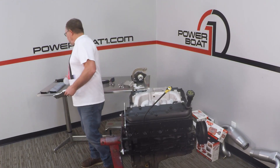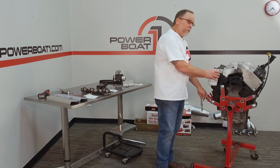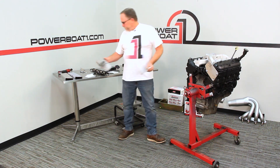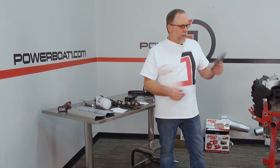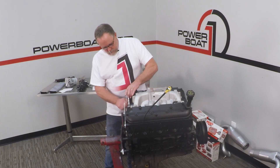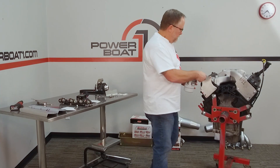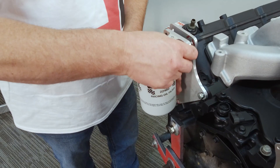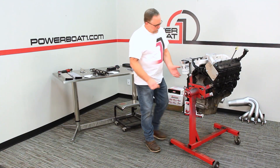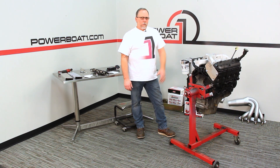Now let's do our oil filter bracket. We want to put our oil filter right up here so it's close to where the oil lines come out from the oil pan — we'll be able to just make nice short little lines right into our filter. If you wanted to run a cooler you could do that too, but we're not going to in this application. Same thing — cardboard template — and it is just going to bolt right in here. It'll end up with three bolts in it, and then we're going to tap the filter into this so we don't have any nuts exposed on the back side. It'll be a nice clean look when it's all together, and that's where your oil filter will sit — nice and easy to get to, the filter lines are out of the way, quick and easy when you want to do an oil change.